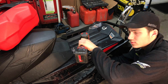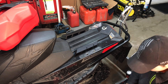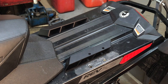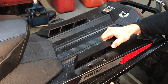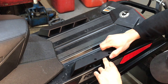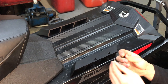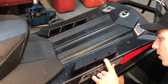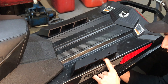You're going to want to reinstall your new shims — these are VRP shims. Grab your nuts and bolts that came with the shims, and do it in the right order: put the nut inside facing downwards, make sure they align in the holes, then put your washer and bolt. They already have yellow Loctite on them from VRP, so you don't have to add any.